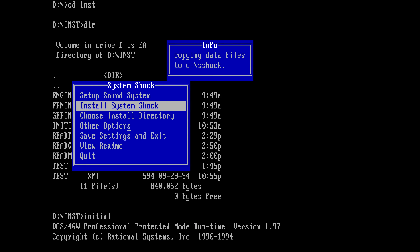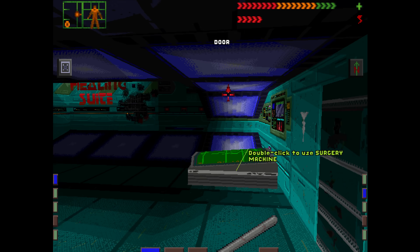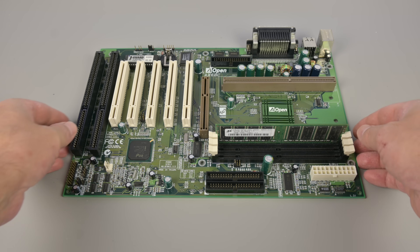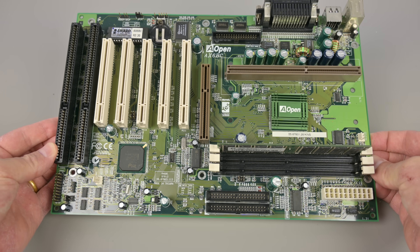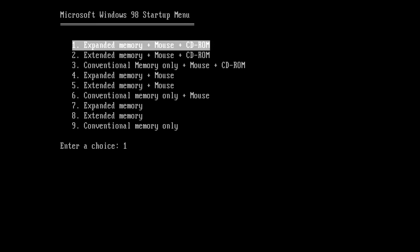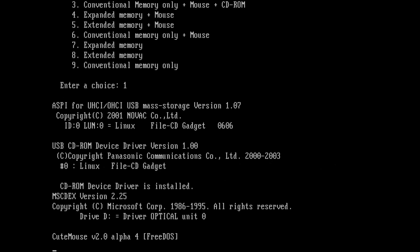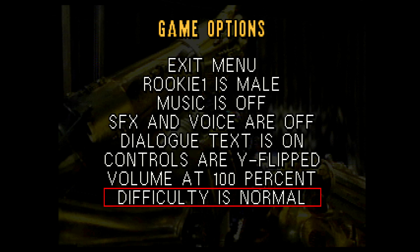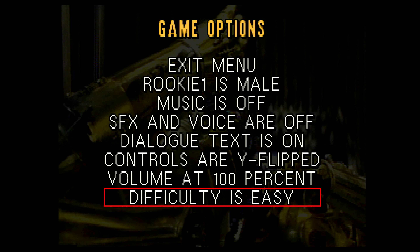This is the CD-ROM version with the full speech and high resolution graphics. Next up is the good old Pentium 2 with the Intel 440BX chipset. Under Windows 98 everything worked just fine. Here we can see me installing Star Wars Shadow of the Empire. DOS mode also worked fine, but here I had to try out a few different CD-ROM drivers and connect the device through a USB hub into the motherboard for some reason.